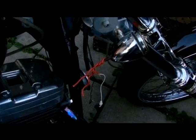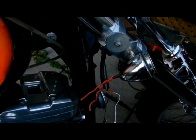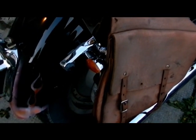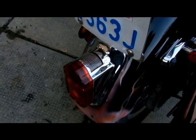You saw what I did here to repair the little connectors. But stupid me — I wanted to put just signal lights with no running lights, but the socket connector is dual and the bulbs I bought are single. So in order for that to work I'm going to have to go buy different sockets. We're just going to put this light together real quick before it gets dark — it's fixed and I'll have running lights, the other one works. Somewhere down the road we'll change the fronts just like we did on the back — just a single signal element, cheaper and easier to replace. For those who don't know about my backlight, I took the OEM board out of the tombstone and put in just a regular 12-volt bulb — a lot easier and cheaper than replacing the board and it works great.